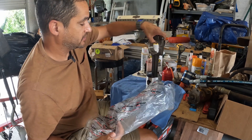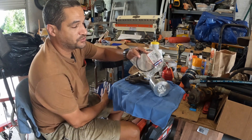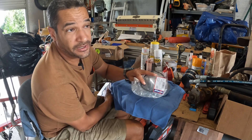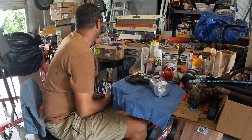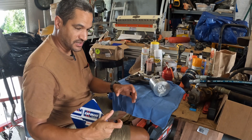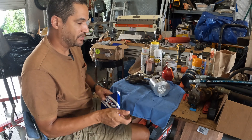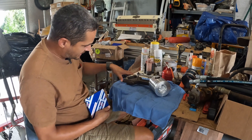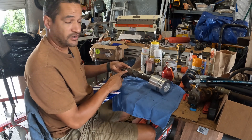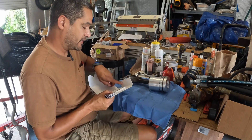This is what we boxed up in the last video. It gives me an extra ring in the package. This was the 5mm ring — I used a 4.7. That ring goes in the bottom of the sleeve, actually goes in the block to protect the bottom of the sleeve, keep the oil and water from swapping places. This is number two piston, and I can tell from the dots on the side. You're going to have compression ring, compression ring, oil ring — that's how it works.